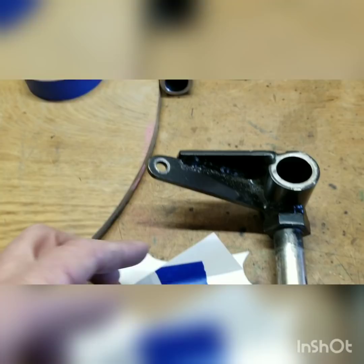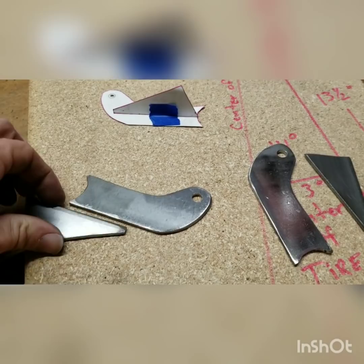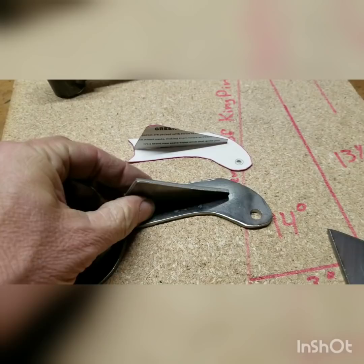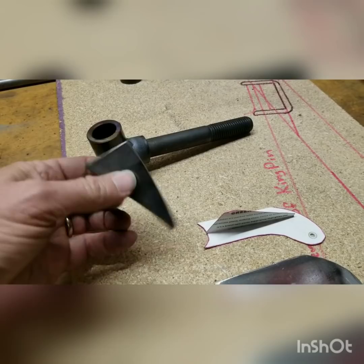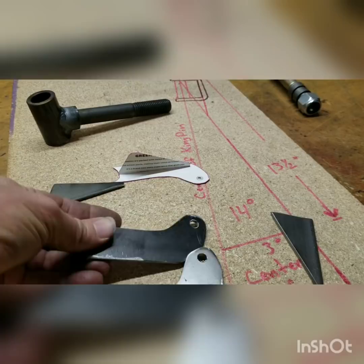So the next thing is to get some steel and make some pieces. So I got the plates cut — this is about one-eighth inch thick steel, and that's going to mount right on there. I turn this around, kind of a mirror image — we do this. Both of them cut and made pretty much a mirror image of each other. I clamped them together and ran the flap disc around to make them nice and smooth.